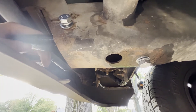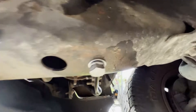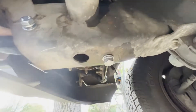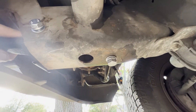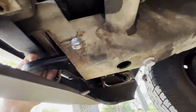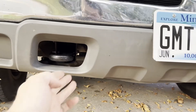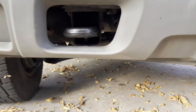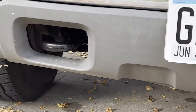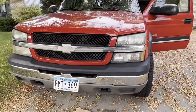The likelihood of that happening is pretty low — the tow hook would probably break first — but I'm a little OCD. I'll pull it forward, tighten the bottom bolt, then hit the side two with my impact. I don't have torque specs but I'd guess 50 to 75 foot-pounds on the safe side. Both tow hooks are now fully tightened down, nice and sturdy, centered in the lower bumper cover cutout exactly as they should be.